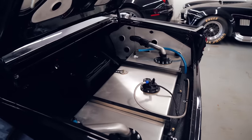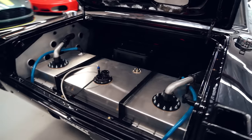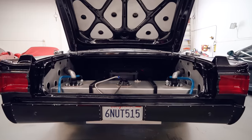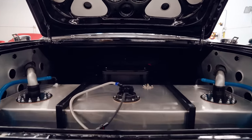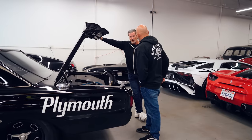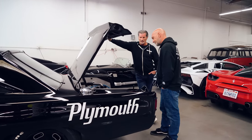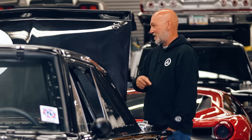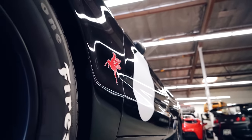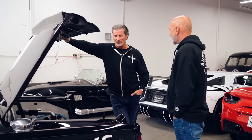The fuel cell back here — because it's a thirsty motor, I've never seen a cell this big. If you look underneath it's actually a T-shape, so it's narrow between the frame horns but fully caged. With the twin fillers I wanted the extra capacity since there's no spare going in. It was built custom by RCI specifically for this car. And to be safe — as much as you like the vintage look — the battery is in a box. Robert's mechanical engineering background adds a lot to all the thought that's gone into how this vehicle was built.